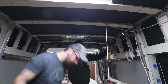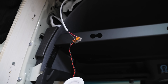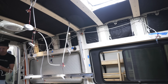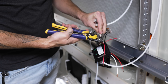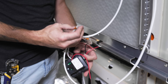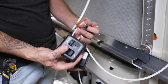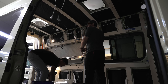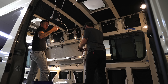Next, we could run the circuit for the puck lights, which will be the main light source in the finished van. These were run on two separate branches, so the back half of lights over the bed and front half of the living space could be controlled independently. Each branch was connected to a dimmer switch, and I personally like this more tactile style of switch in this application. Once everything was connected, we could test the lights and they worked great — no flickering when the lights were dimmed, and these should provide plenty of light inside the van.